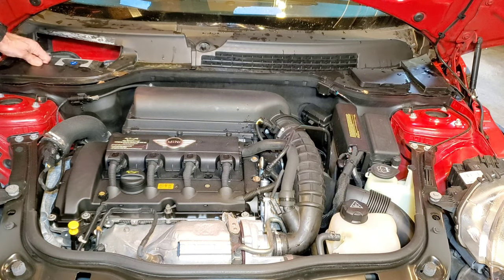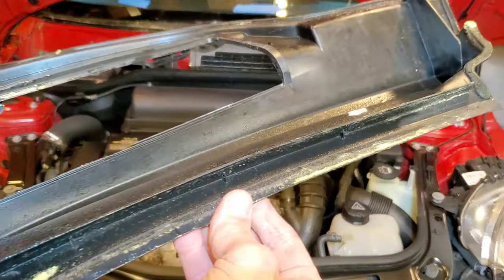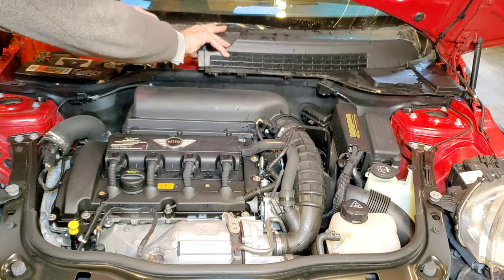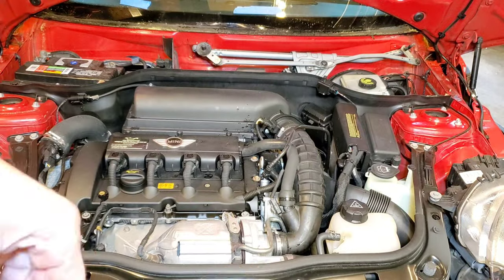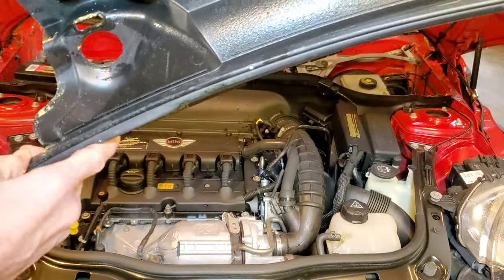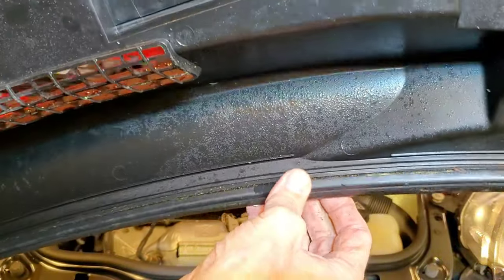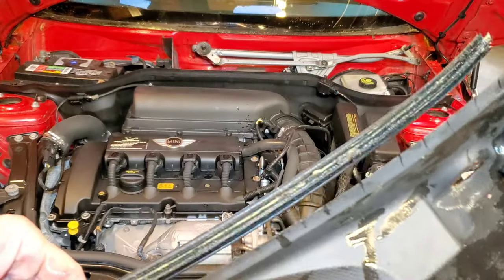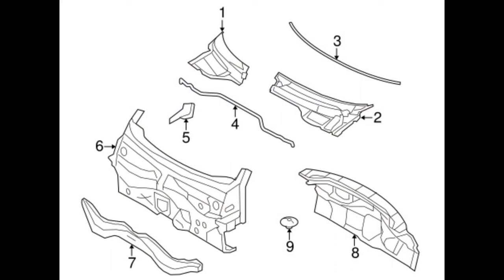This sticks a little bit — this is the passenger side cowl. You can see the rubber is really brittle. There's an alignment strip that attaches to both cowls, and you can see it's still attached to the driver's side. It just snaps on underneath — they call it a seal strip. This one's in good shape, so we're going to hang on to it. There will be some links in the video description if you need to order another strip. On most parts diagrams, the seal strip is numbered three.